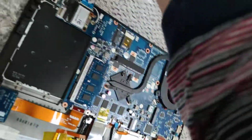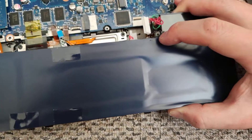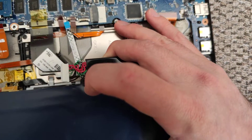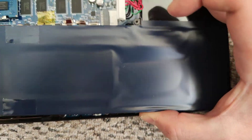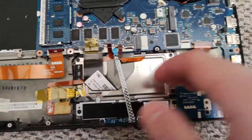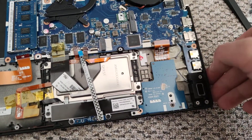The battery has one screw. It is placed on the corner here and screwed into this hole here, so it's very easy to get the battery off. Take this screw off and you have better access to this part here. As you can see, you have this connector — I think this is a card reader.